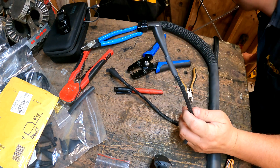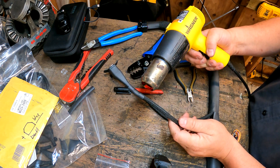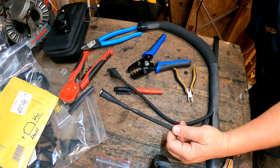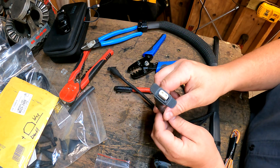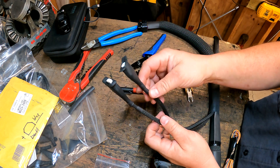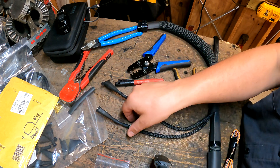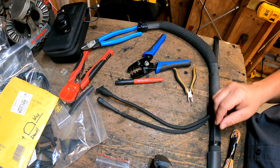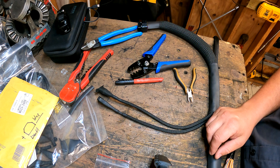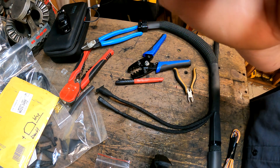One of the reasons I'm using these injectors is the nice, tight connection. I've already had them rebuilt — I had some clogged injector problems. They are good to go, and from my research looking at the CCs, they will flow way more than I'm going to need. So my first two connections are done and I'm super happy with how this is turning out. I'm going to work my way across, skipping the connections under the air box, do the injectors on the other side, and then we'll take a look at the crank trigger and some of those other sensors.